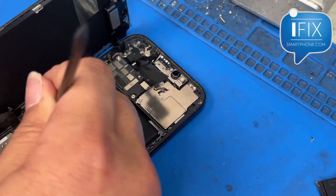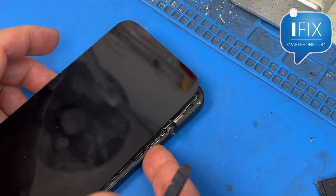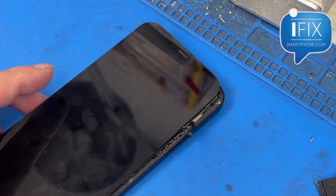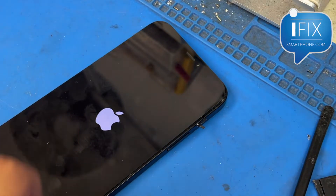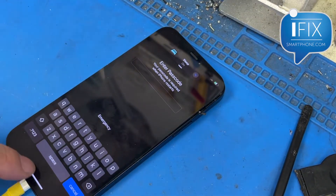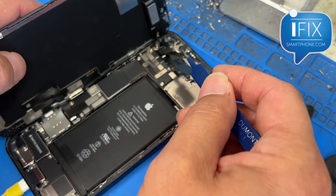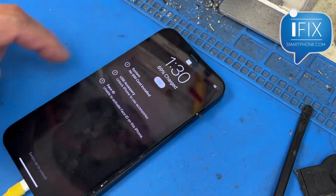The connector is all connected, and now I've got the tester proximity sensor. I try to boot it. There we go — you can see a message that says Face ID is not available, because we didn't transfer the data sensors over. But with the working proximity sensor, you can actually see the phone is fully functional.